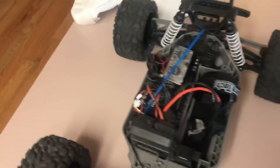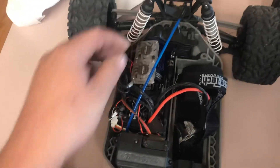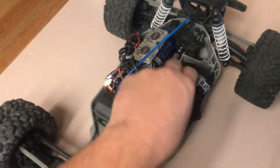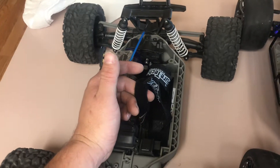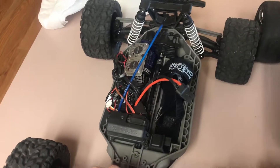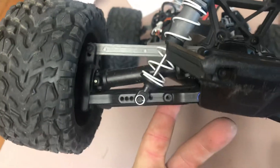The body is not easy to get on and off right now. I am running a Mamba X 3800 kV motor and running 4s on it. I had to get a battery strap set up because the stock Rustler battery only requires 2s and 3s, so I had to work around that. Other than that, everything else is stock — I'm running the stock drivelines and they seem to be holding up.